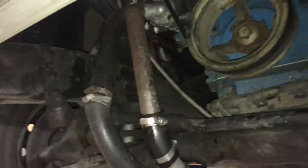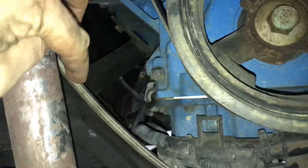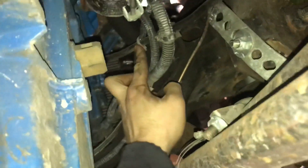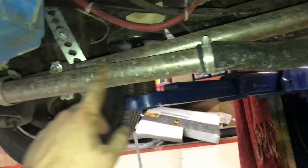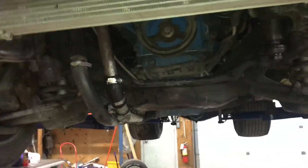Besides making myself look like a fool with three gallons of coolant running out, it'll also have a good chance of boiling over and blowing up the engine. So we're going to fix that today. The plan is to come down with these two hoses and run directly into this cavity here between the engine block and the crossmember. I might have to move some wires around up here by the starter, but there's a pile of room. This should only be an hour or two — but if anybody knows the rules of hot rodding, it's probably going to take all night. So let's get started.